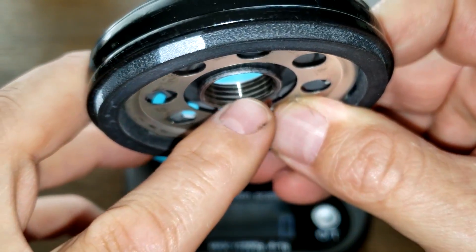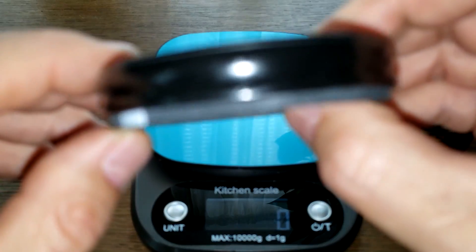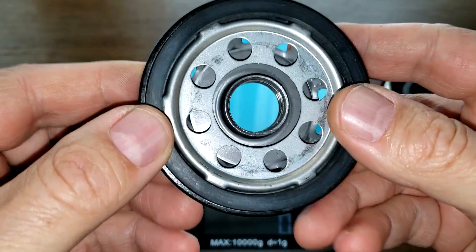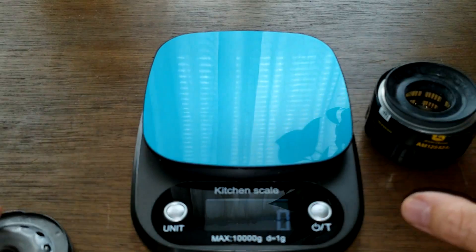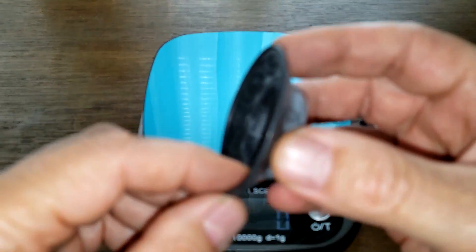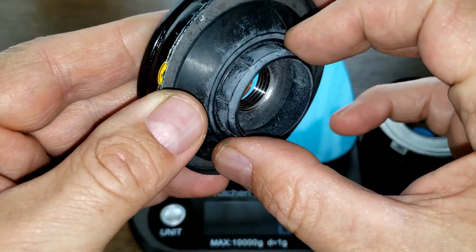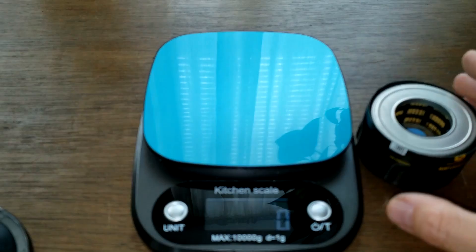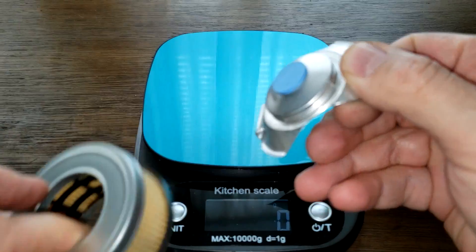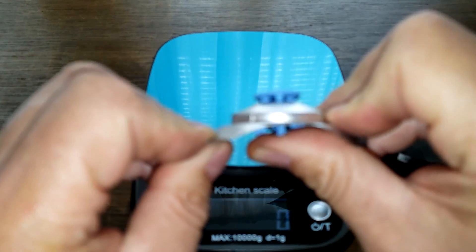It's got a nice amount of threads and a nice thick o-ring gasket. There's your rubber anti-drain back valve to cover up all those inlet holes. And here we have the stamp leaf spring for the bypass valve.